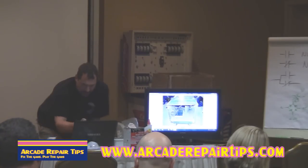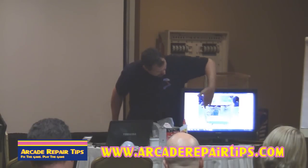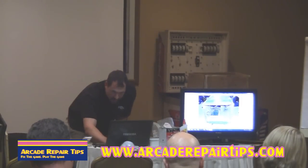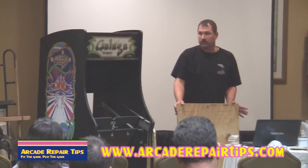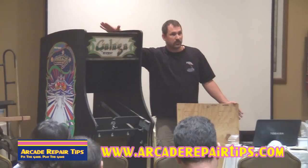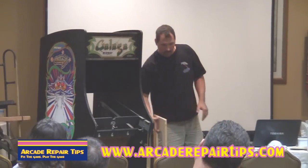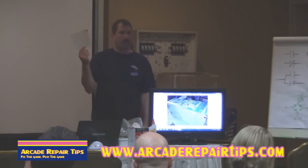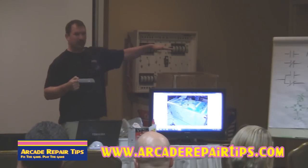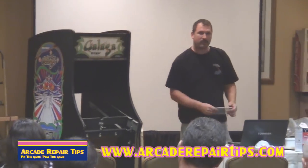Here's the bottom of that machine again. Notice the main board is still in there, and I've moved the transformer up onto the side so I can get in there and start assessing more damage. I can make a new back door — I've got templates for Miss Pac-Man and Pac-Man. I use particle board just like this piece here to drill out the holes in the back. Everyone sees those little vent holes on the back — you know what you can use? A gutter cover from the hardware store, about three bucks. Use wire cutters and a staple gun — you can't tell the difference.